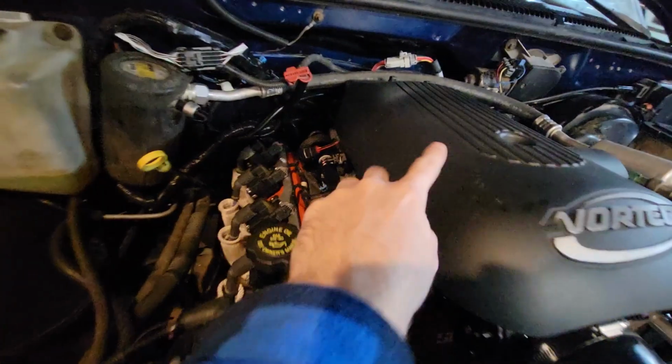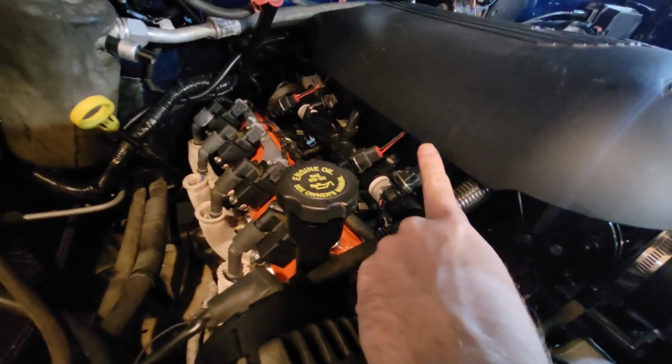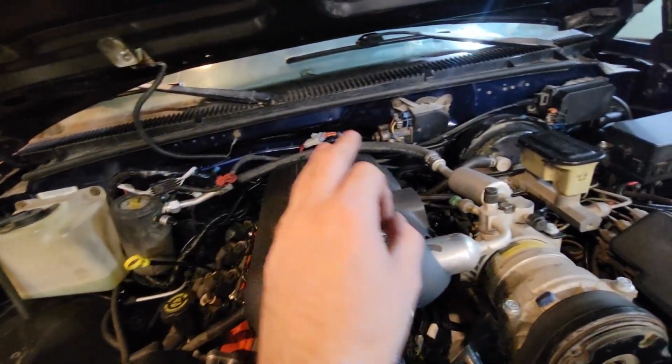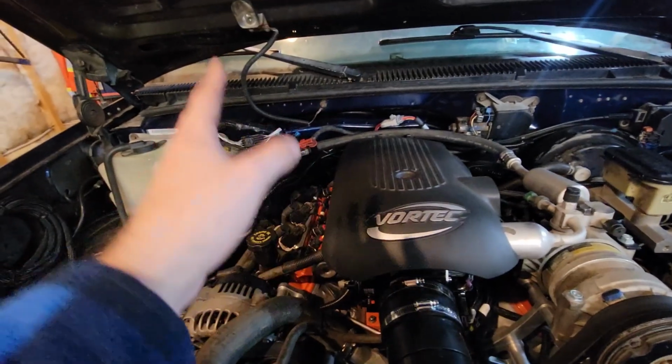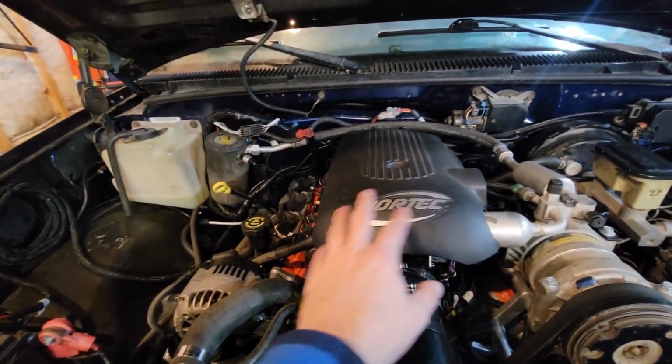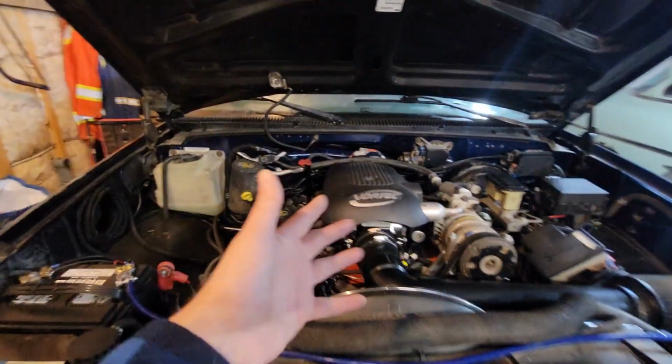So yeah, next video we're gonna be setting up the fuel system, the fuel pressure, because I think I'm having an issue on the one side, and it could be fuel pressure related. And I'm thinking if the computer can read fuel pressure, because here I'm just gonna show you guys what I'm talking about. On this side, I got a fuel pressure regulator, okay? And then it comes over to this side and it just does its thing. But there's a fuel pressure sensor dealy over here. So what I'm thinking is there really is different fuel pressures on different sides of the motor. Why this side's not spitting and running cleaner, and this side's spitting and running like shit. So I'm hoping that the fuel pressure sensor will tell it what to do. So stay tuned for that. That'll be next video. And then after that, the dash.